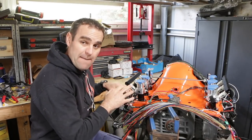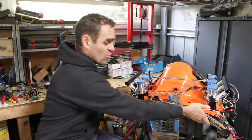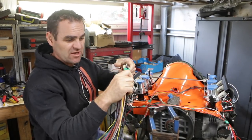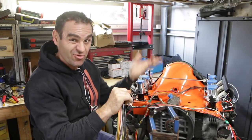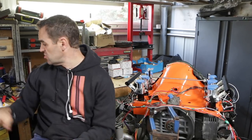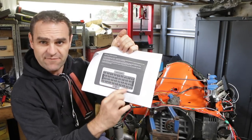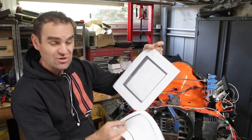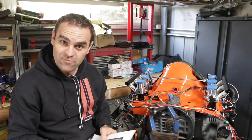I've finished all my power and ground to all of my coil packs and the power going through to the injectors. That's all laid out, and I've laid my A and B looms from the Link ECU over the engine. From last week, I put some tape where I know they're going to come out in the car so I can line them up on the engine so the whole thing will actually fit. I'm going to start laying out the individual wires using the installation guide, which has a pin-out for every single wire and tells you what colour each wire is. As I go through I'll fill out what each wire is going to, so that it's all cross-referenced and we have a wiring diagram we can troubleshoot with later.